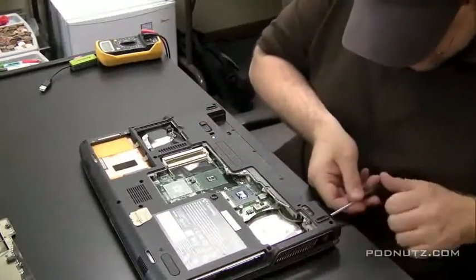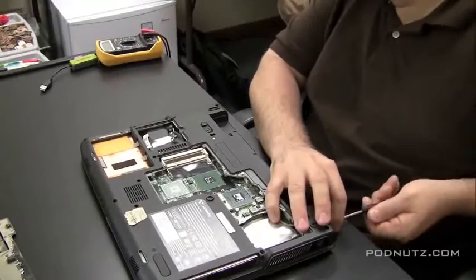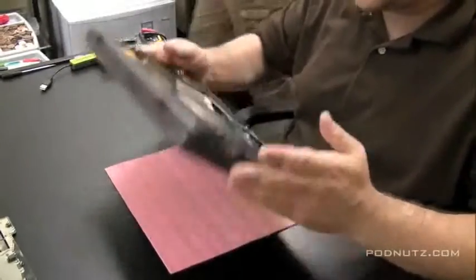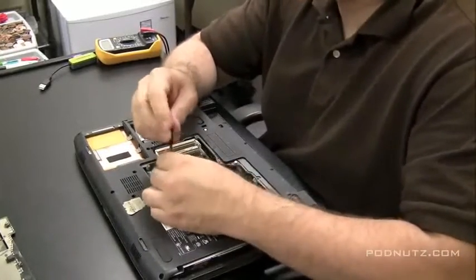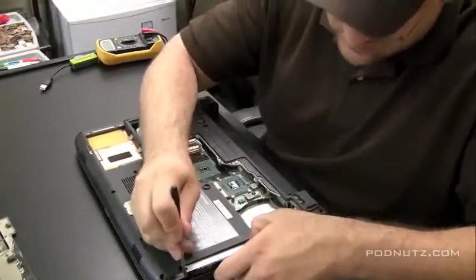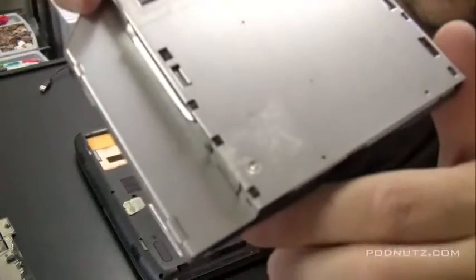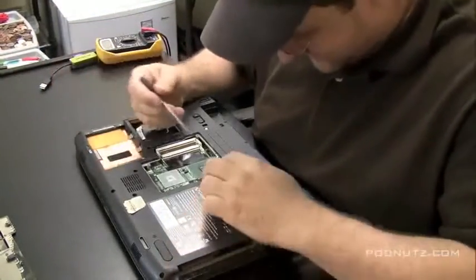And since I'm right here, I'm taking the two screws out of the back of the computer — sometimes there are screws in the back holding in the hinges. There's one screw holding in the DVD drive; once we get that screw out, push on the tab, the DVD drive pops out. And this drive is damaged — there's no front cover. You can actually see water damage there. That's not a good sign. Hopefully there's not major damage done to this motherboard. Always look for water damage: white spots on the board or on the hardware.